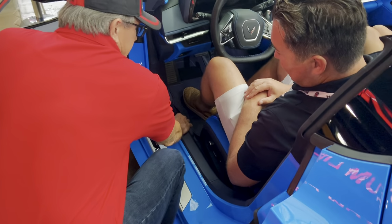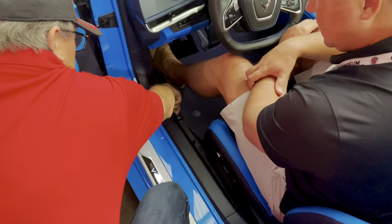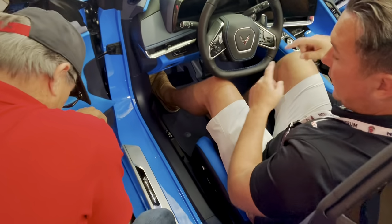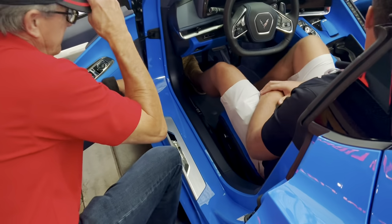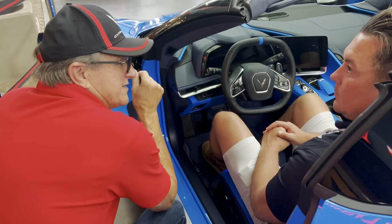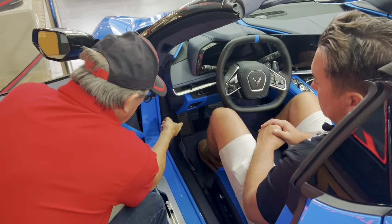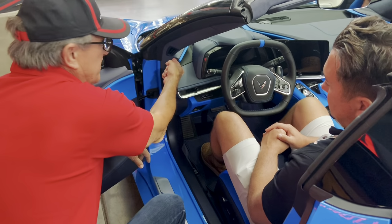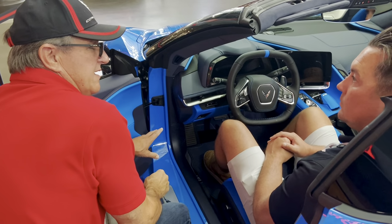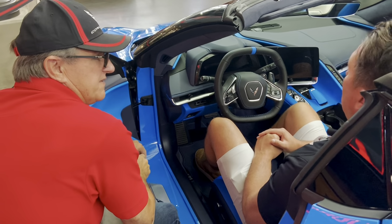And then, like I say, since you never had one, if you're ever in this and the main battery goes out, you raise that up and allow the door to open. Okay. Is that on the other side as well? Yeah. Now, if that main battery ever goes out, it's up front, that's electric. But you would literally have to lay down and put your head about where your feet are, but in the front firewall, left of the brake, up pretty high, is a cable that's got a loop in it. Pull it two times, it'll pop.